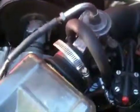I want to turn this around to the side and run it down here, because when it's out the front here, the hood pushes down on the whole carburetor. Or if I can get a different flange that comes out straight, it would even be better. But I have a 377 one, but this Tundra flange is a little bit bigger on this side. And I'm still waiting for my 60mm air breather doodad there. So that's about it.